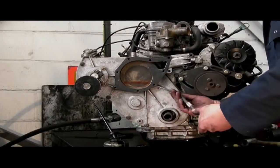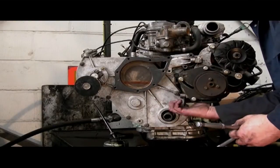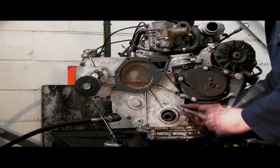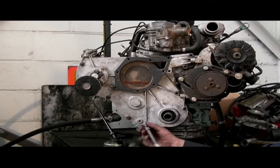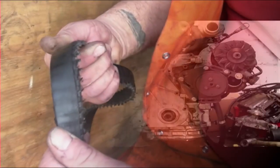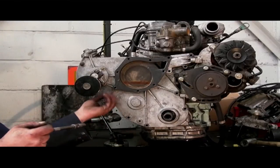Be aware — you'll have to fit them back in once you've taken the timing case front cover off to hold it in place. Remember there's a gasket underneath and you don't want it to move too much — keep it all even. The timing case front cover bolts vary in length and there's a reason for that. You need to torque them up correctly all the way around so the casing is kept straight, otherwise the belt will run untrue. It's not unknown for a timing belt to wear on the casing if the casing's twisted and then snap.